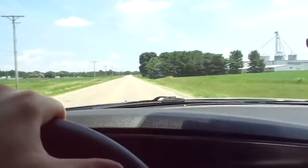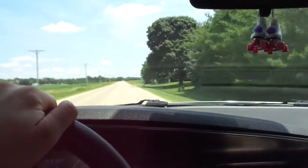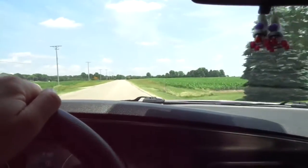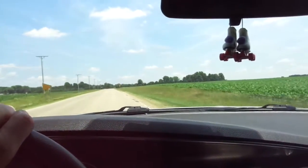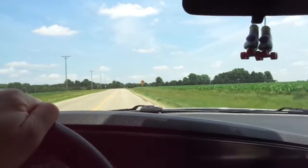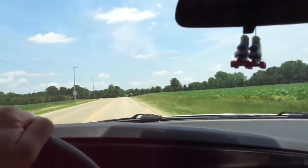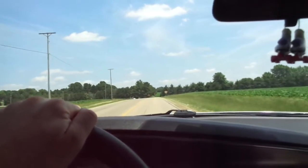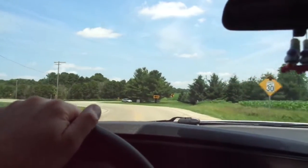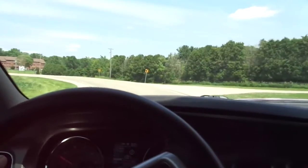Alright. Anyway, shifted through all the gears, and once it built pressure, within the first couple seconds, man, it quieted down, sounded really good. Like I said, it shifts really nice, so I don't think there were any issues before. I don't know if it was supposed to take 5.3 quarts or whatever the computer said. But I only drained out 3, so I put a little over 3.5, about 3 2/3, back in it, and it seems to be fine.